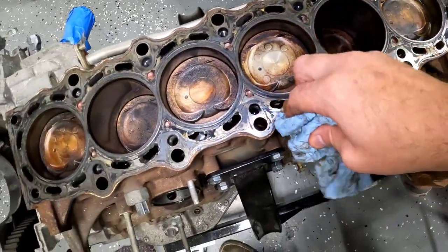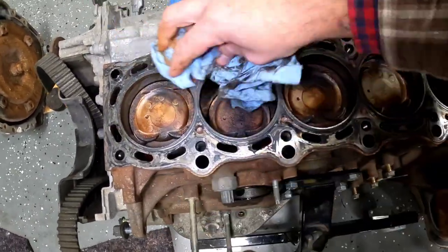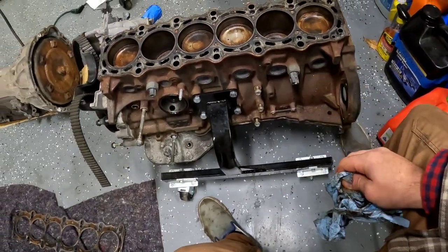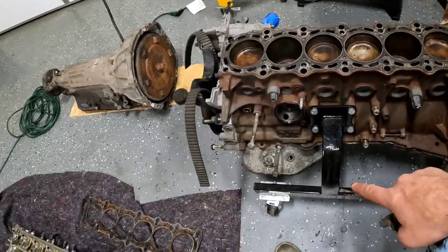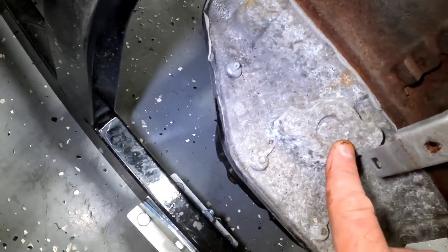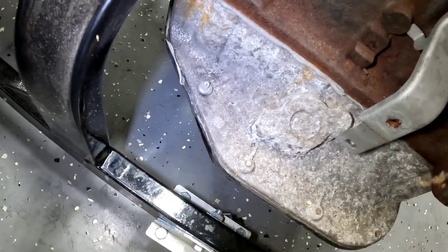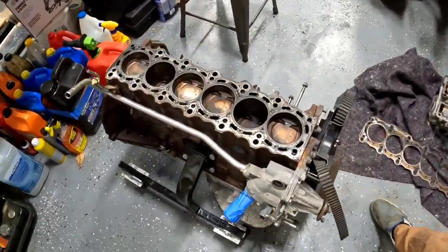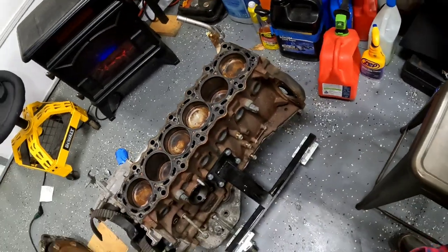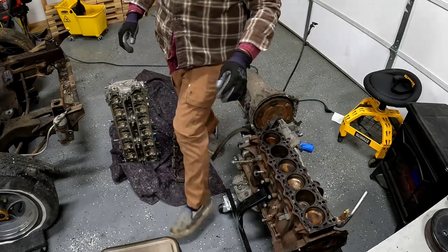I'm pretty happy with this thing. I think it's going to clean up nicely. For now I'm going to put a little bit of Marvel Mystery Oil in each piston — just kind of let it soak. That's pretty much as far as we're going to go with this thing today. I do want to take the oil pan and the lower cradle off because I'm going to have to modify this. That's a 2JZ GE lower cradle and they basically still have the casting from the factory — they just don't drill it and tap it for the studs. I've got an AZ Performance fitting on the way for that. Let me see what the head looks like underneath. Oh man, this thing is going to clean up and be brand new again — it's in awesome shape.